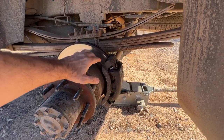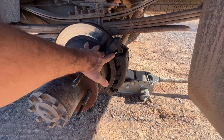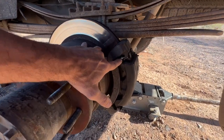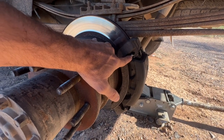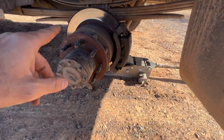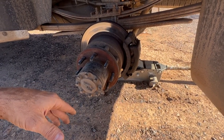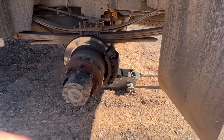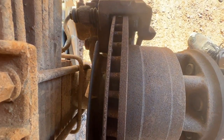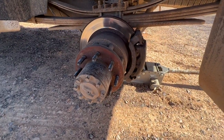I did a brake job about a week ago, and this is why I know something's messed up. Whoever owned the truck before me and did the last brake job — they ground off these tabs right here. These tabs tell you when your brakes are getting low so you don't go metal on metal. These were gone. So in between the drive from Texas to Arizona, I didn't hear anything wrong, but there was a lot wrong. Look at how thin the back side of this rotor is — it is nuts and marred up hard.